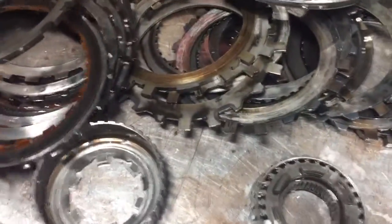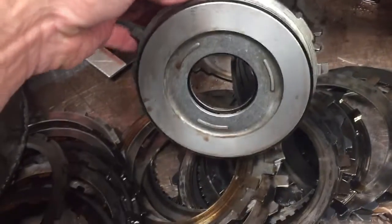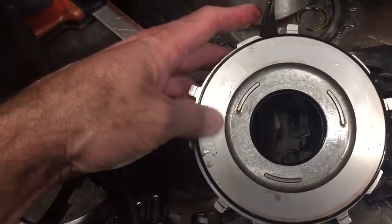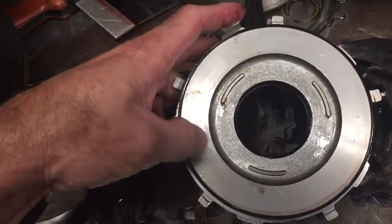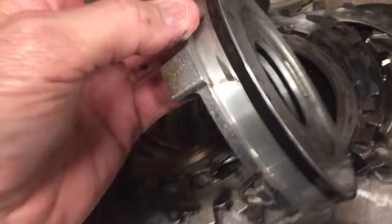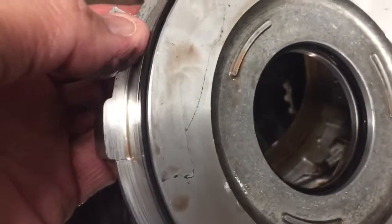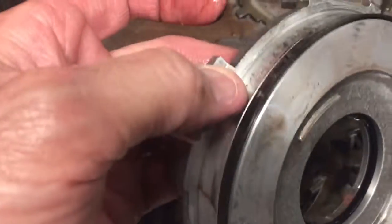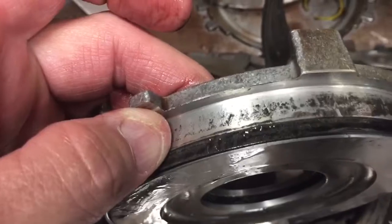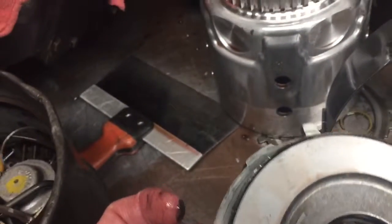Here are your 3-4 clutches. This piston assembly can be upgraded — these are actually prone for failure. And it looks like this piston is actually broken. The forward piston is cracked, and there is a billet one available, which would be a clear explanation of why, when you get on the throttle heavy, you could pull through.